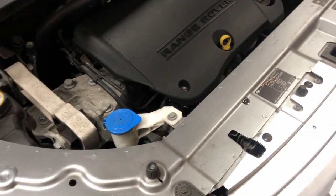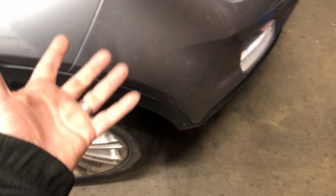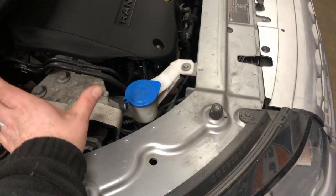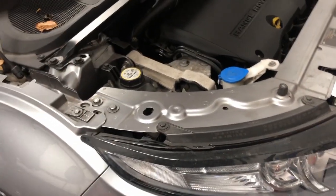I'm going to film as much of this as possible. The basics are removing the engine cover, this pipe, the engine mount, anything that's in the way, the wheel, the wheel arch liner, and anything underneath that we need to get to. We'll need to drop the coolant out otherwise it's going to go all over the floor. Then strip all this down to get to the cam belt itself.